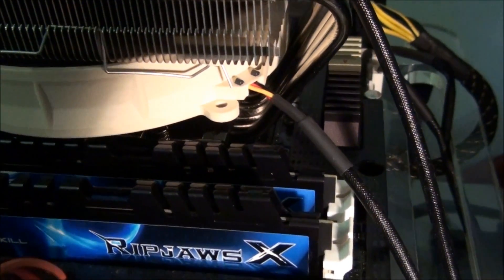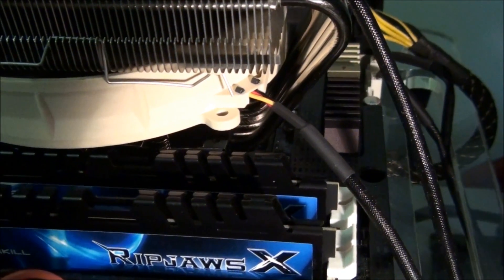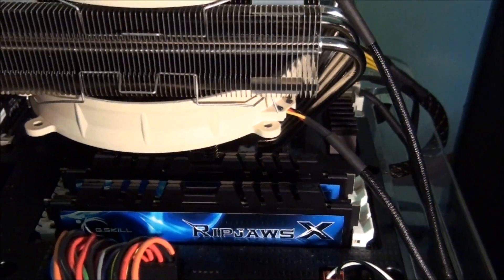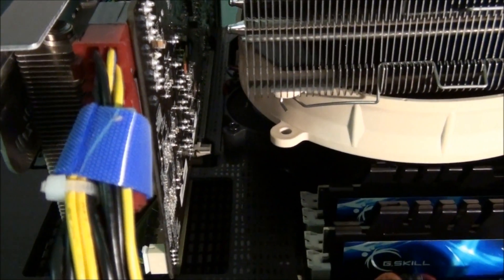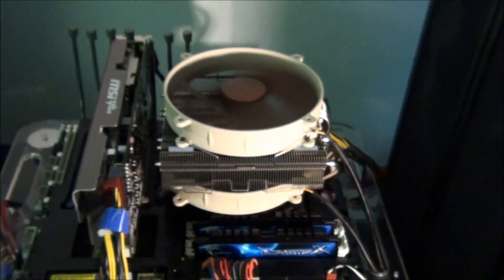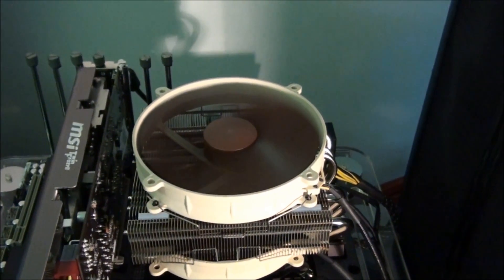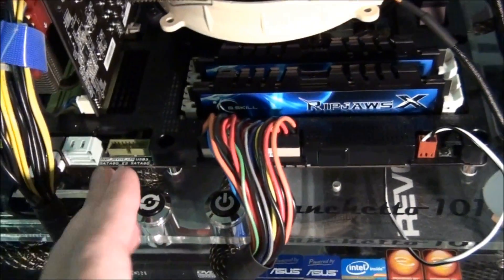The thermal armour has a large gap around the CPU and is also hollow around the CPU, so the air that blows down onto the CPU area can actually get under the thermal armour — which is the same area where the assist fan is, with a gap in the thermal armour to allow air to blow underneath. Basically, most of that air being blown down onto the motherboard goes under the thermal armour, spreading right across the PCB and coming out around the edges where there are gaps.